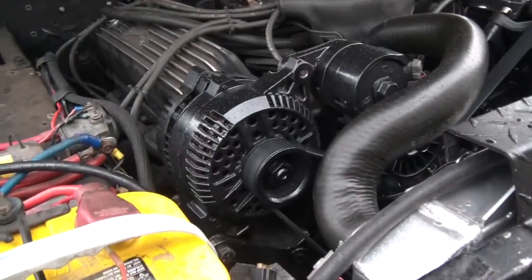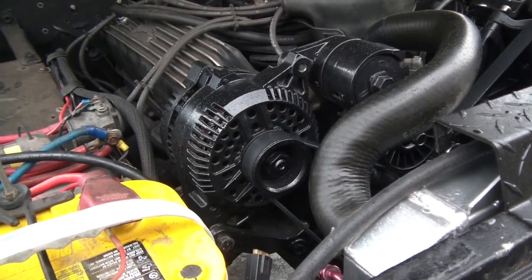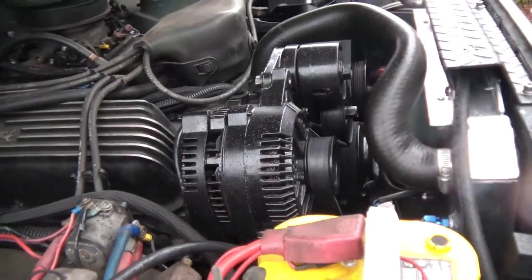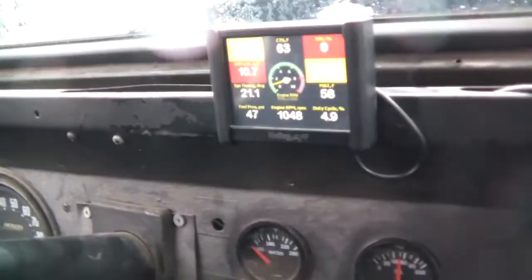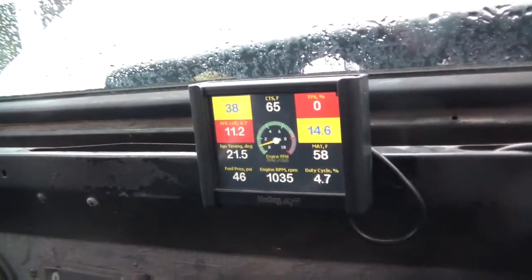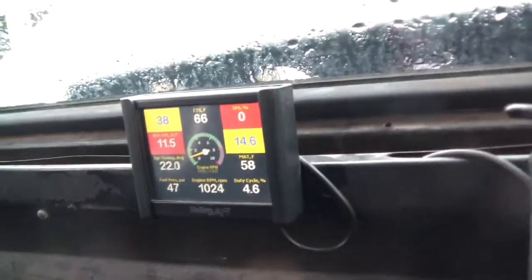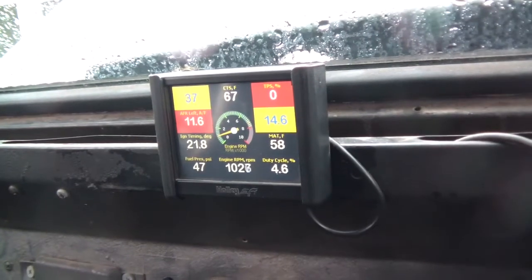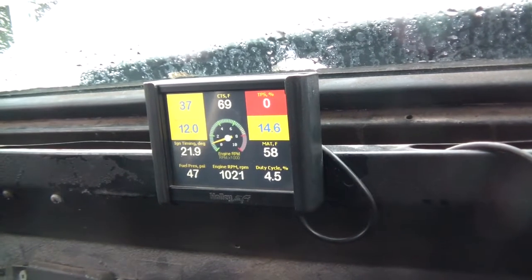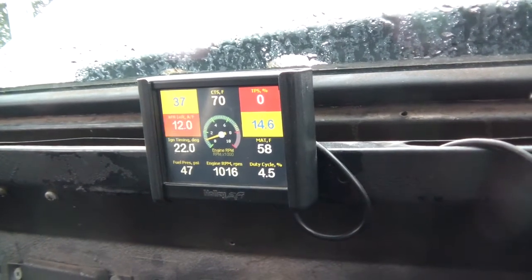The 3G is installed. I'm doing a quick fire-up — it's raining right now. I just wanted to quickly show this thing is working and charging. Reading 14.6 volts. If it were in the 12-volt area it wouldn't be working, but 14 volts means it's charging. You can see how simple that was — just a couple of wires and that's it.